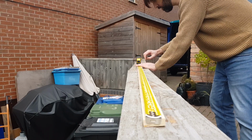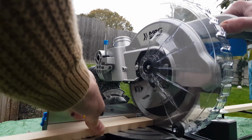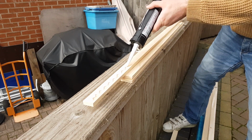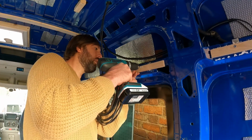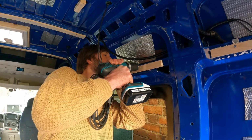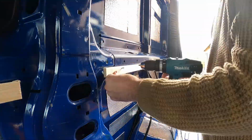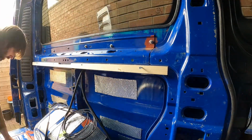For the walls, the timber that we used was 12mm thick by 34mm wide. Having pre-measured before buying, we thought that they'd be the perfect size for the contours of the van. Above the wheel arches, using a multi-tool, I had to cut out a notch in the timber. For all of the bits and pieces that I use in this video, I'll drop some links down in the description.